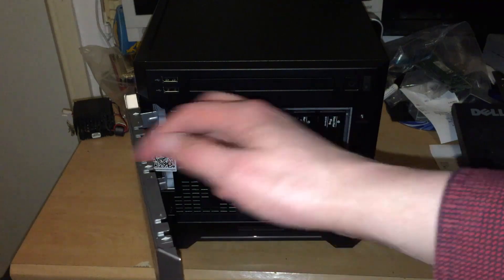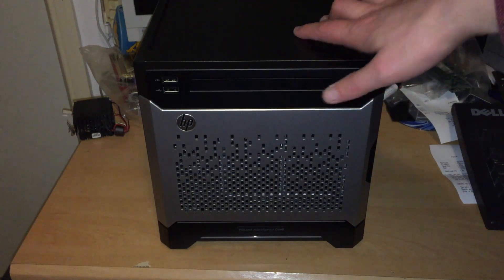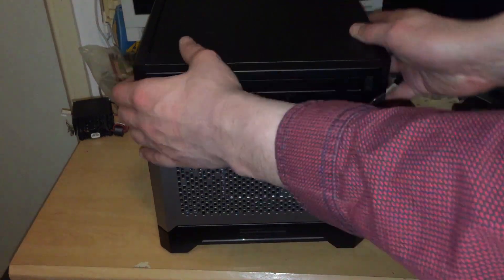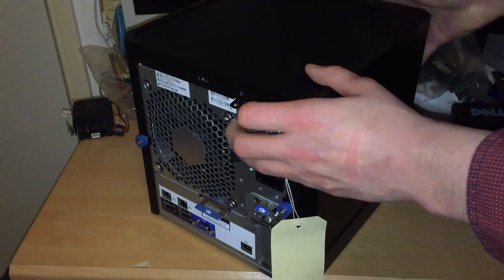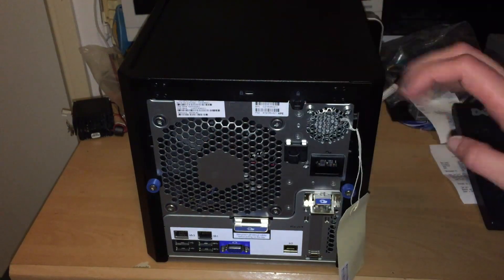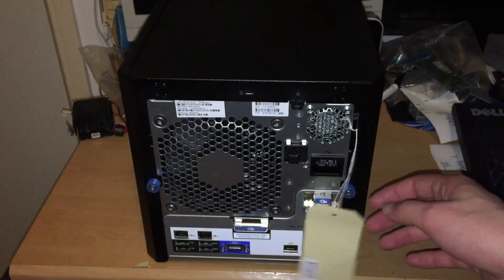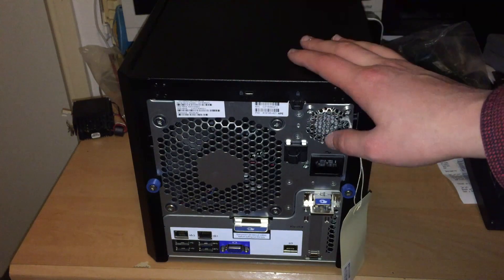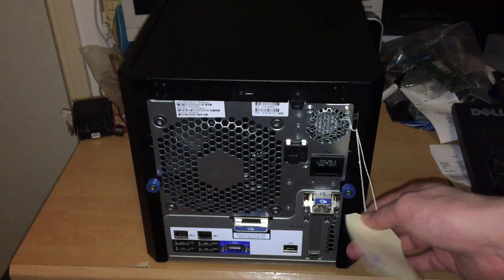We've got four drive bays, currently two of them populated. We'll be taking out the Western Digital drive from the Mac Pro that's used to serve virtual machines — it will be wiped. Maybe I'll just use it to transfer some VMs; the management server is probably the only one I'd save. I'm not going to save the vCenter virtual machine because it just hogs RAM — the vCenter appliance takes like 8 gigabytes of RAM to run. This server can only take 16 gigs; it currently has 4, and we'll be upgrading that in this video.